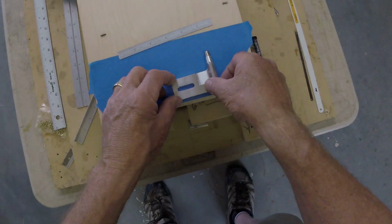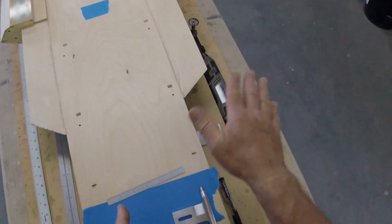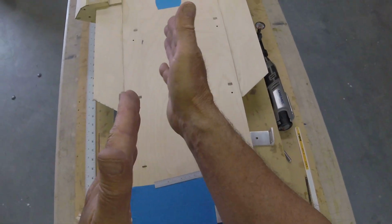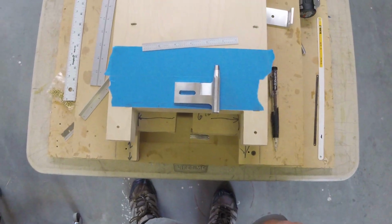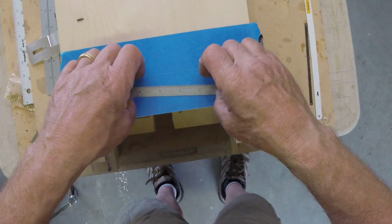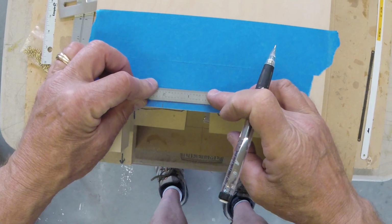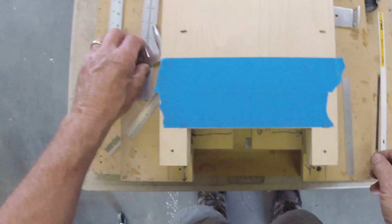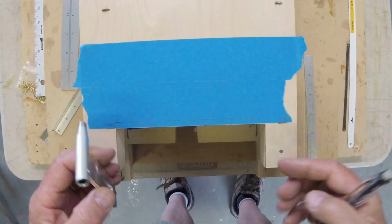Yeah, now it would be really cool to go way over here and really thrust that boat into the turn. The problem with that is when the boat's riding, you're, you know, walking on the water, you're also lifting the prop up out of the water. That's no good. But we are going to bias a little bit of angle by bringing it over this way. How much, you say? 1/4 inch. If this is your center line, we're moving over 1/4 inch. The center of my strut now lands here. It's not much, but it's a thing, right?